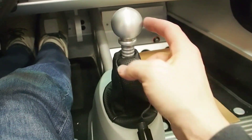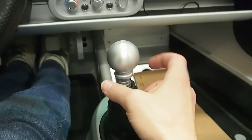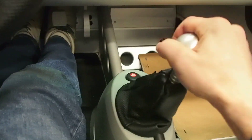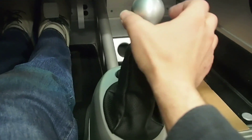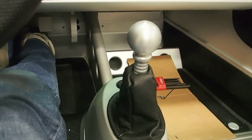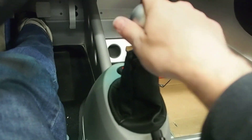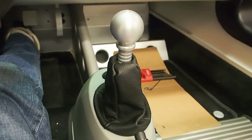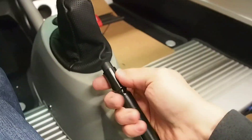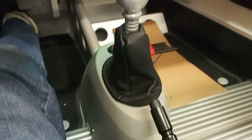Shift action — I did my centering adjustment and there's not much play in there. It's good. I'm going to vacuum a little bit, put the seats back in, and then I'll be done in here. I've also got to put the pans back underneath the car, and the brake lever handle. And then this job is all done.